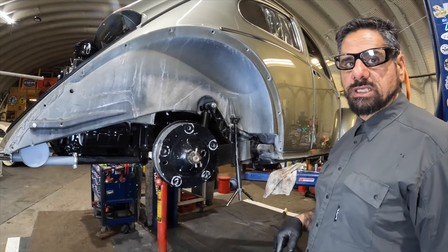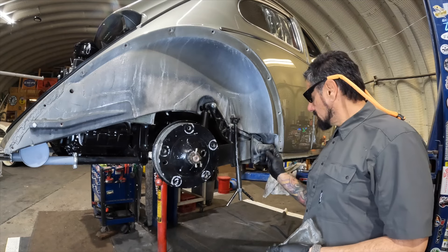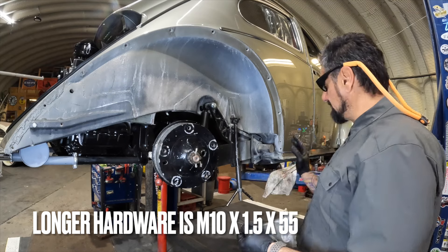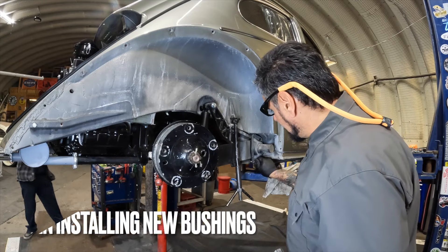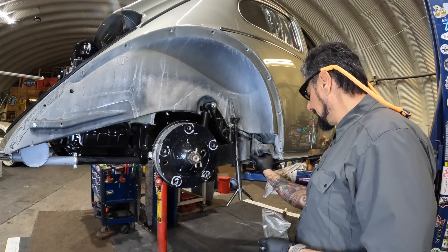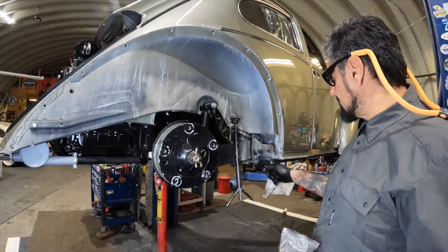We're going to get that cover put back on, snug it up, and put this thing back down on the ground to see how she looks height-wise. As seen in my other torsion adjustment videos, the hardware that comes with is usually too small to bolt your spring plate cover back on, so I use longer hardware, cinch it up, then go back and replace each one individually. The longer hardware lets you pull away a little and get a better angle on tightening — it's up against the rubber bushing so there's some give. In the book they recommend two studs at a diagonal to push the plate on, but I don't have those studs, so this is the way I do it.